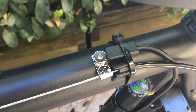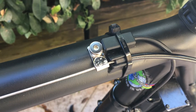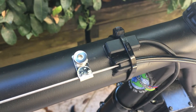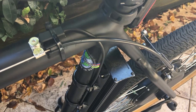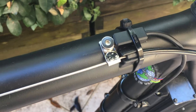Once you've got that done, you can reattach your brakes and then stick on the magnet — the little circular magnet that you can see now on top of that bit of metal — and that's right next to the sensor. So when I pull the brake cable, it'll move that magnet away from the sensor and that will cut out the motor. So when you pull the brakes, you don't have the wheel turning at the same time.